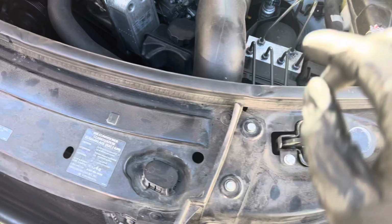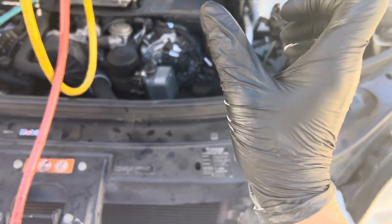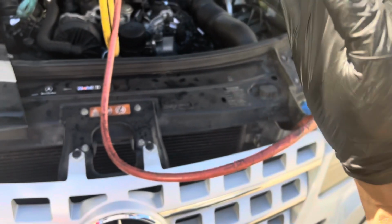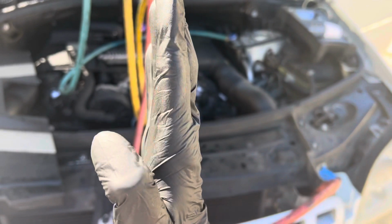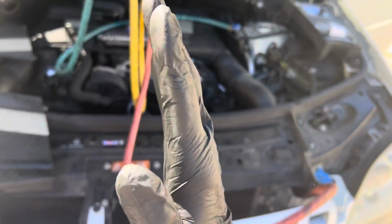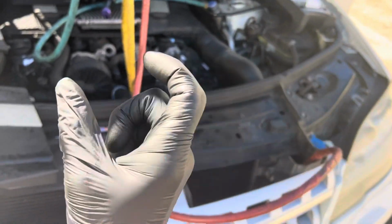It's a clutchless variable displacement compressor, and we already know now these have a lot of problems with the solenoid and the compressor either not working, or sometimes something is stopping the signal from actuating the solenoid in the compressor for the compressor to actually come off its zero throw. So you have a rotating disc and you have pistons on both sides, and you have a place that has a variable displacement, and as that actuator hits that plate, it pushes the plate, but the plate spins at the same time, so it starts wobbling as it's spinning. And the more compression you want, the more displacement you want, it'll push it at a further degree, so as it spins, it wobbles and it pushes the pistons with a longer stroke, a longer throw.